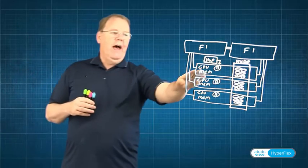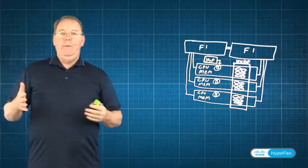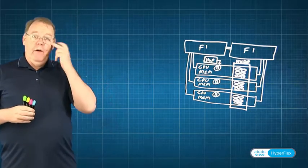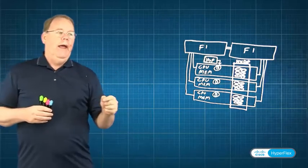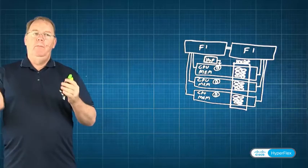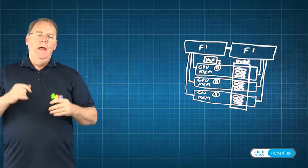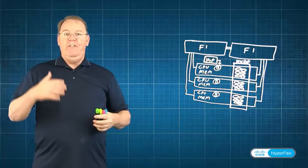The first thing we have is we have CPU and memory. That's the first basis. We need that CPU and memory to run our virtual machines. We take up very little amount of RAM when we run our system, and that hypervisor also needs a boot mechanism. So we put a boot mechanism in there in the form of an M.2 card. This is our place where the hypervisor is going to boot from, and it also is shared as a VMFS store.